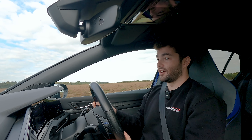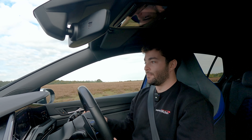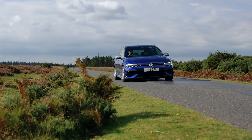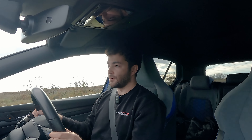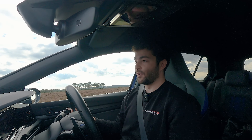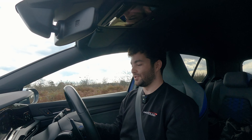Even with quite a lot of steering angle and a big bump, the car settled really, really quickly. The thing I thought was really letting the car down before was the tyres — it's only running Dunlop Sport Max tyres, a bit of a step down from the Pilot Sport 4S it had before. But with this suspension you can really feel it getting all the grip it possibly can from those tyres. Better spring rates, much better damping, and more sophisticated dampers to control wheel and body movements — it feels really, really good, even on not particularly good tyres, which is probably the most impressive thing.